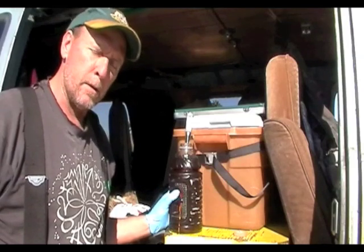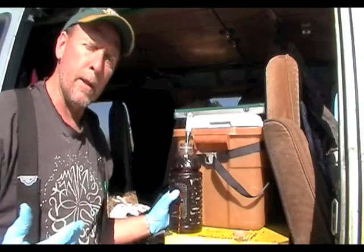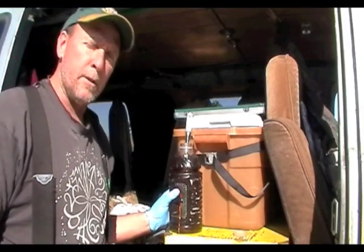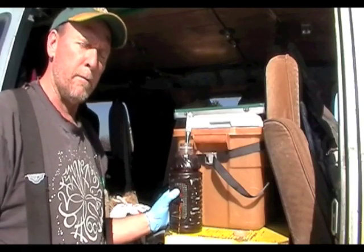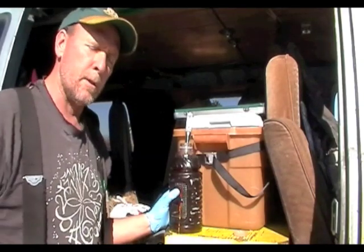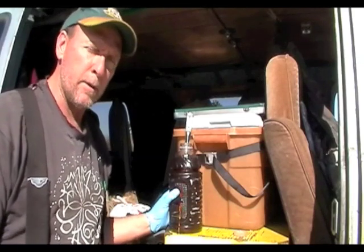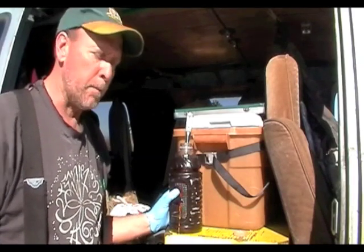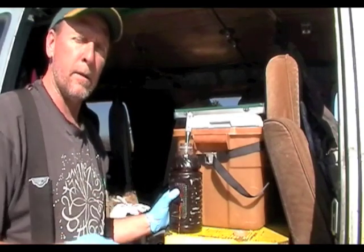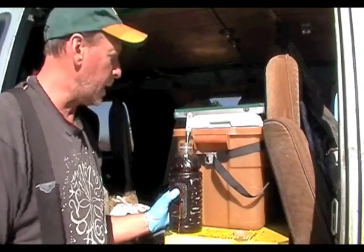And my theory is that what's going on is that periodically they add a petroleum distillate like gasoline or diesel fuel to keep their biodiesel from gelling in the wintertime, and the action of putting a petroleum distillate with the biodiesel forces incompatible components out of solution, and they precipitate out in the bottom of the tank. And indeed I found when I added gasoline to this sample, some incompatible components precipitated out.